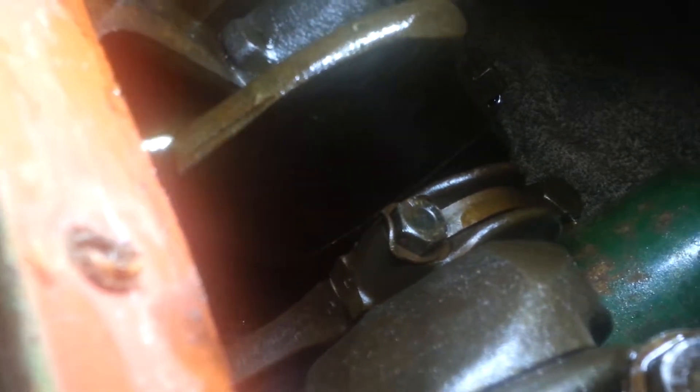One thing I must do is mark them — I'd love to do that before we get them out. I think when this was rebuilt they are marked, you can just see it. There's a little mark — number two, number two there, and that's got number three on it, and three on the conrod. Very important to get that right, because if they've been machined to the bore — around the other side of the piston there's numbers — you have to make sure you get those numbers lined up and check that all the big ends are the same size.